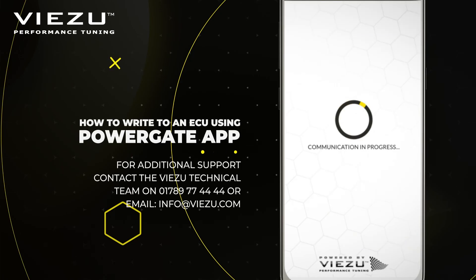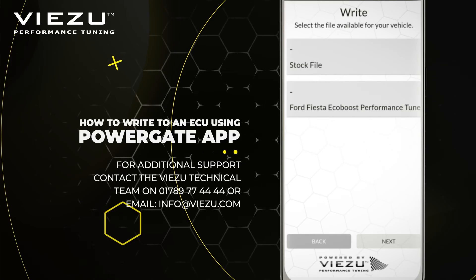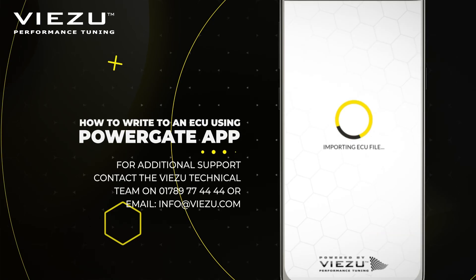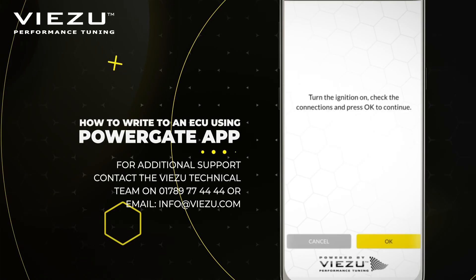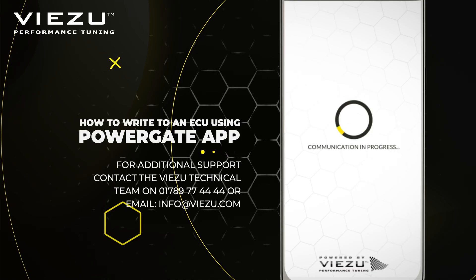Select the writing option on the main menu and click Next. This will take you to a menu screen where you can select the file you wish to write to your vehicle. In this case, we will select Ford Fiesta EcoBoost performance file and click Next. It will then ask you once more to connect a battery stabilizer — please do so if you haven't already. Once connected, press Continue. It will then tell you to turn the ignition on — please do this and click OK to continue.